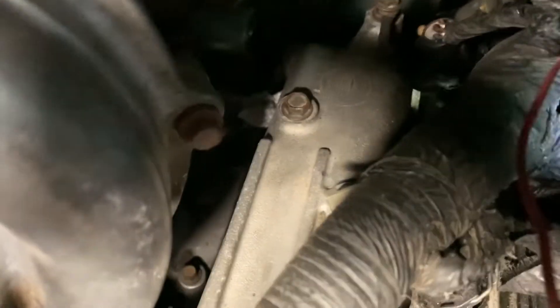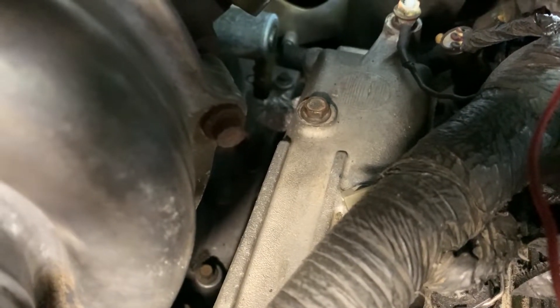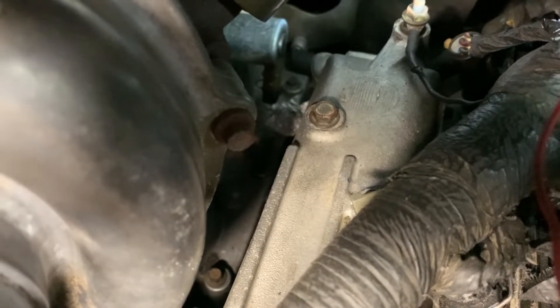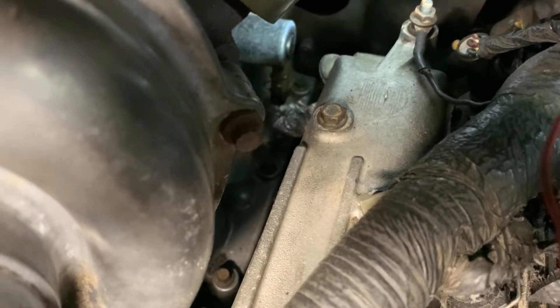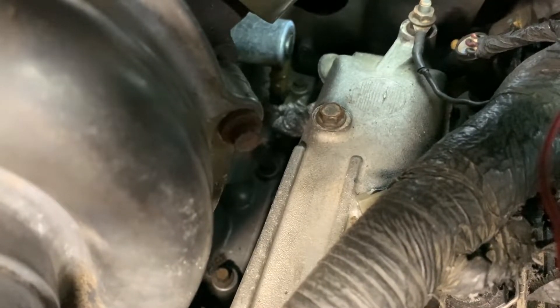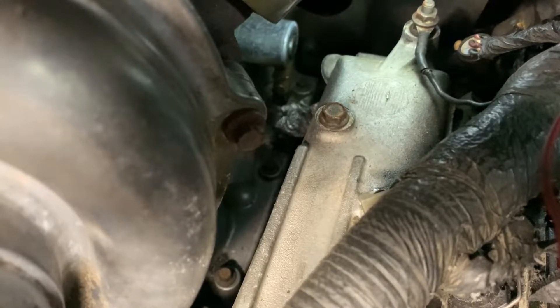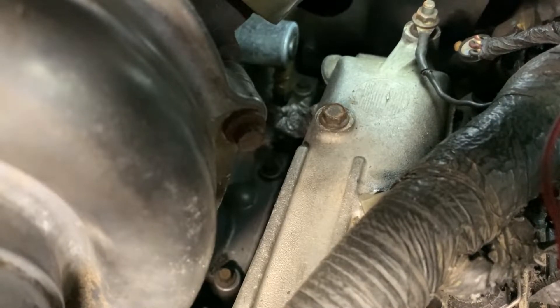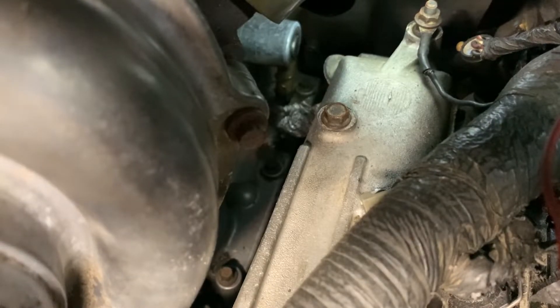There's your IPR right there. There's the electric plug — you flip that little thing down and unplug it, then we're going to slide that socket over it where it has the opening, go around the electrical connector, unscrew that, screw our air tool into it, pressurize the system, listen for leaks, and it's going to point us in the direction of whether we've got to go after the high pressure oil pump, or which side of the motor. So let's get this IPR off.